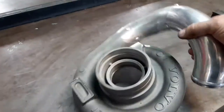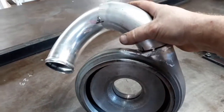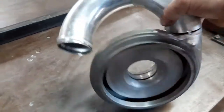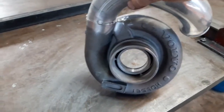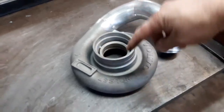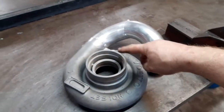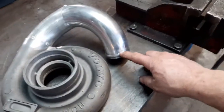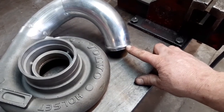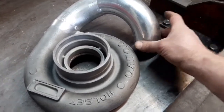This is my compressor housing. As you can see it's a little bit weird, but that's just the way it has to be. Fitting a three-and-a-half litre V6 into the back of a little tiny car takes up a bit of room, and this is the best solution I can come up with. I've tried to make this as flowing as possible, coming around the turbo in a nice arc — not changing angles or direction, it's sort of all like a big snail. I've given myself a bead on the end and about 30mm of straight so the pipe can clamp onto it.